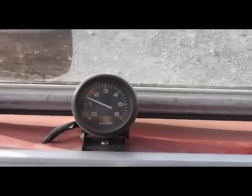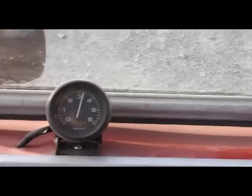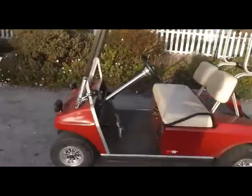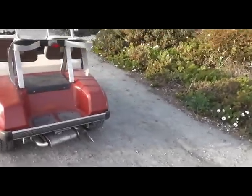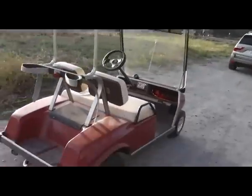As you can see, it runs very well. Stock engine breath is pretty good. I'm going to have to put a little thicker oil in it — I've got 5W30 weight. Since the governor is off, I'm going to want to make sure I have optimal lubrication.